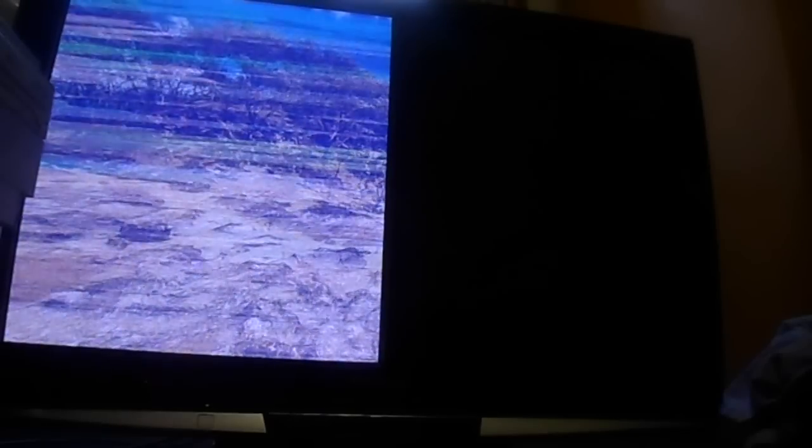When you get an SU failure or an SD failure, usually half the panel will give issues, but it will be a vertical split instead of a horizontal split. The only board that splits the picture into two halves is the D board, because it has two large processors on it, so a failure in one of the processors could cause this symptom. So we'll talk about diagnosing this problem, and the D board is available for around £20, so it should be a fairly cheap fix.